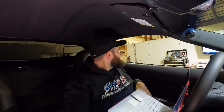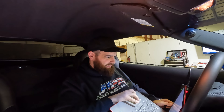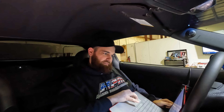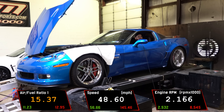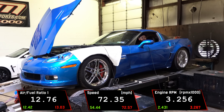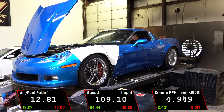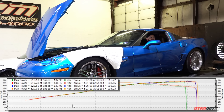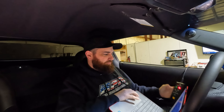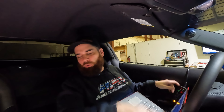It liked it a little bit: 527, 506. Not bad. I'm going to lean this out a very tiny bit — one and a half percent — because I don't know if one is enough and two might be too much. That's now the second time I've ever done a half percent. So let's see. Got 529, 507. Got a little bit of knock at around 5100, but the cats might be hot. I'm going to let this thing chill for maybe 15-20 minutes, let them cool off, and then make a final pull.